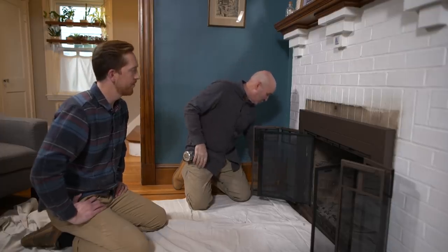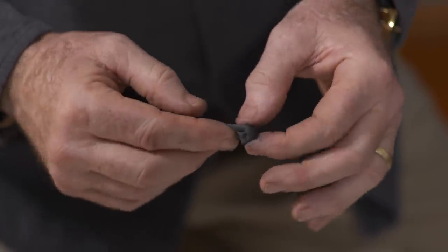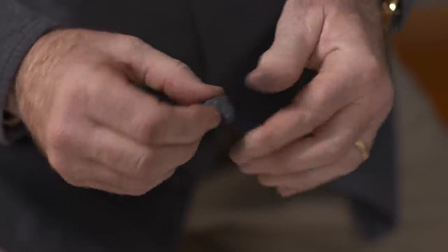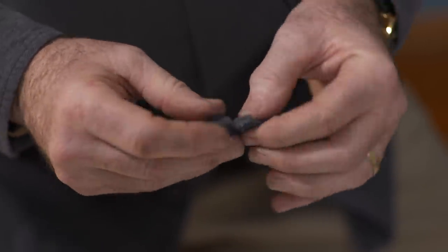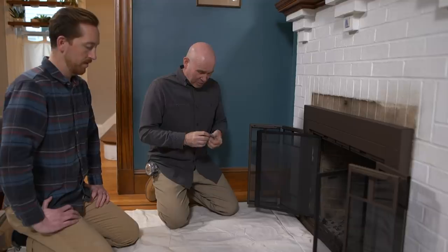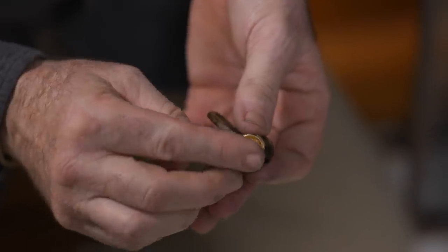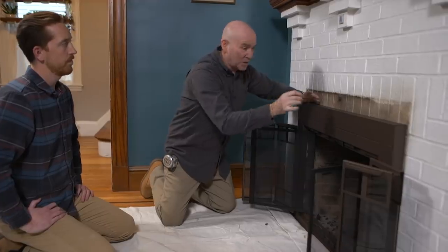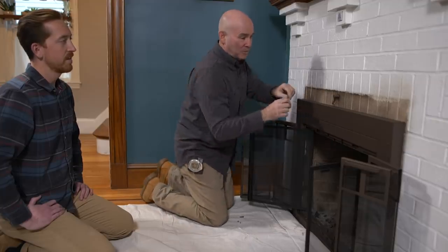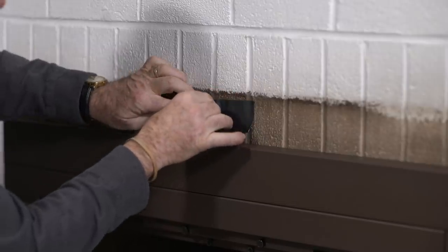One more problem — it's probably the biggest problem we had: the knob. What I'm going to do for that is, I have a little epoxy putty. I want to mix this putty until I get a consistent color — you can see I have the black and the gray, and I want to mix that all together. Once I get one color, I know I'm ready to go. Epoxy putty is an easy, inexpensive way to fix a sticky or stripped rotary damper. We're not going to need too much epoxy, and just for aesthetics, I'm going to start the knob pointing down. Then I'm going to take a little bit of tape — keep this tape on for 24 hours — and that's just going to keep this knob in place while it sets up.